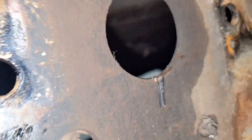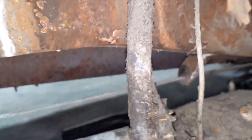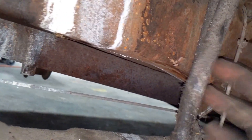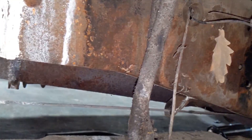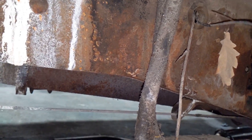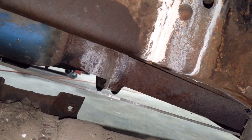Here's the filler neck — I should probably replace that gasket. On the mounting brackets you have those studs. I'll probably address the frame while I'm in here. There's one on both ends and they sit in that big hole there — that's what holds the tank up. So I'm going to pull the old fuel system out, slide the tank out, drop the new one in, and show you what I've got going on with that pump unit sitting on the cart over there.